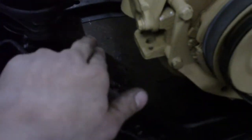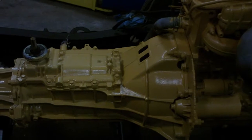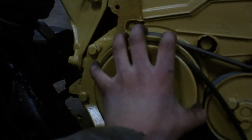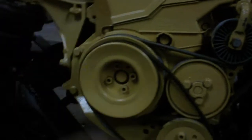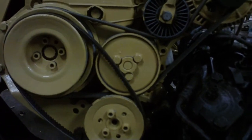Other than that, the engine mounts are all Volkswagen — the rubber mounts are all Volkswagen. I just welded custom plates. After I mounted the engine and tranny together, I rigged up the tranny to the Ford mount crossmember and got my angles how I wanted them. The power steering pump was a little bit of a concern but I got enough clearance there, and basically from there I just let it sit on the engine crane and made my mounts how I wanted them to get it to sit right in that exact spot.